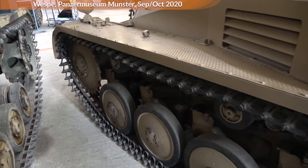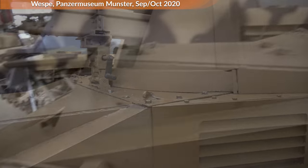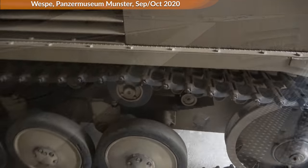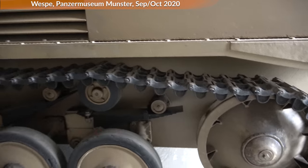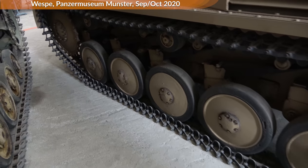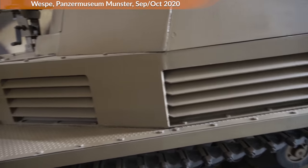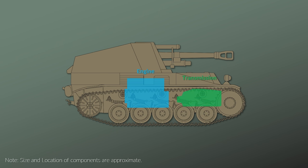Most of you will see that this is very similar to the Panzer II chassis, although there are some notable differences besides the superstructure. First, the front is quite different — the driver sits in the middle in this little compartment here. From the side you might notice the Wespe has one less return roller; you can see there are only 3, whereas the regular Panzer II has 4, although early versions according to Spielberger did not have these changes. Furthermore, spring buffer stops were added to the track wheels to deal with the recoil. The engine was moved forward, and necessarily the cooling system louvers were redesigned and placed in the center.